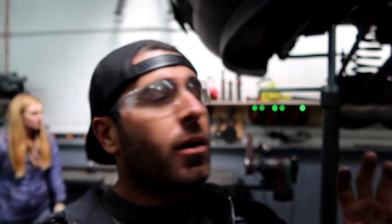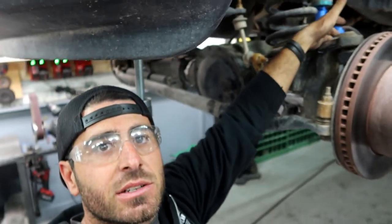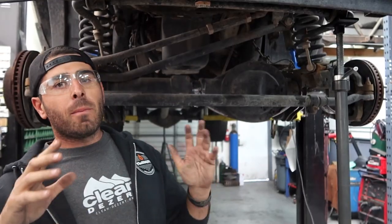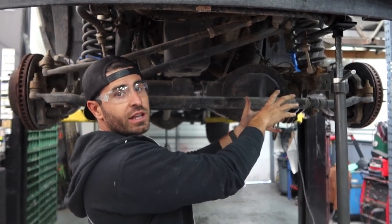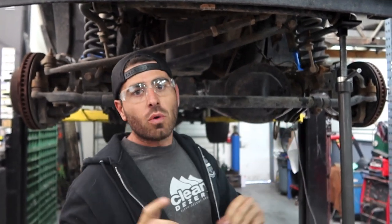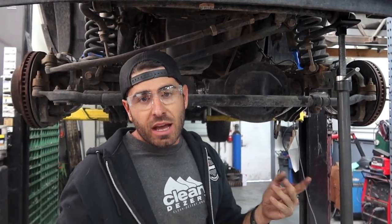We're gonna go ahead and tack up the first tube, tack it in place, and then start to fit all the little gussets where they belong. We went ahead and taped the shocks because there is a gusset that goes up here, so you don't want to get any welding splatter on your shock shaft or your brake lines — keep them protected. One big thing when doing a project like this: you cannot create too much heat. So you tack everything into place, then you'll do some welding over here, jump to the other side, do some welding in the middle — all while letting it cool so you don't warp anything or overheat the ball joints.